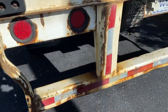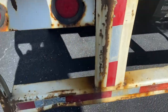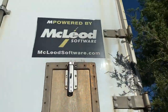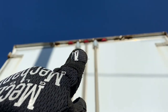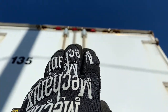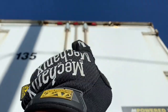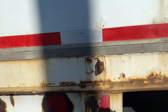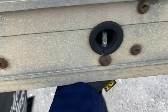Mention that the DOT tape on the rear bar is present and that the bar is not bent, cracked, or broken. I picked a difficult trailer to demonstrate with because this thing is all messed up. Also mention the marker clearance lights on the top — some trailers will have three marker lights on the top, just mention they're not cracked or broken. And mention your safety latch or door safety latch on the side is also not missing or broken.